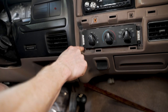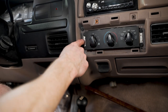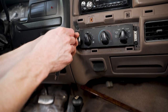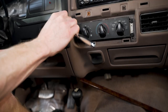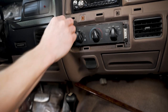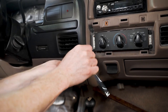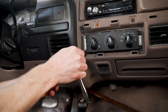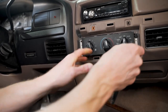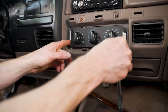With that out of the way, here are your HVAC controls and your four retaining screws — two per side. These are the common areas where it's broken or damaged, and the screws may or may not be there, which is probably why you're installing this repair bracket. For the sake of this Bronco it's all intact, but we'll run you through the steps anyway. I'll back all four seven millimeter screws out and then show you how to disconnect the electrical connections and vacuum controls on the back of the HVAC panel. When you have all this off, it's also a good opportunity to clean out dirt and dust from the nooks and crannies.